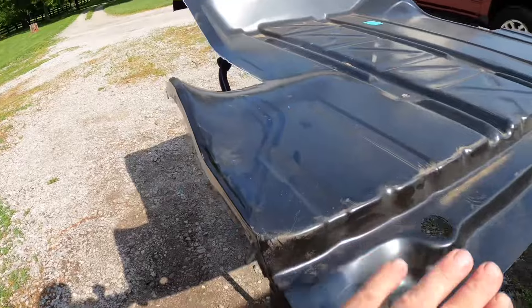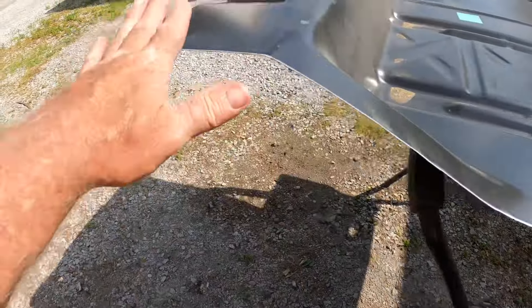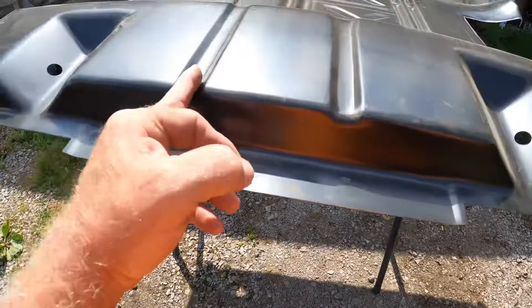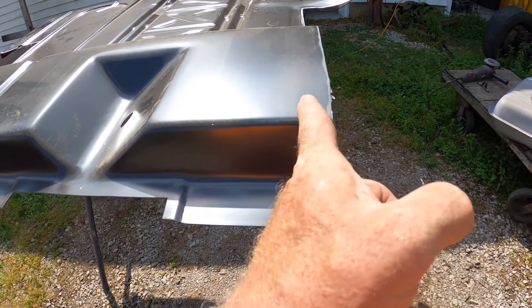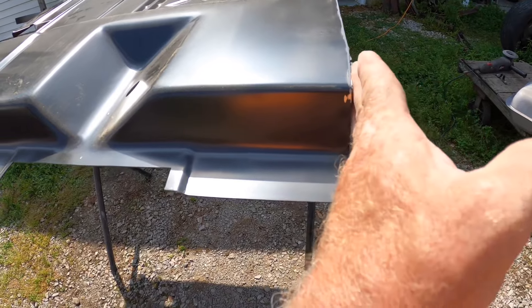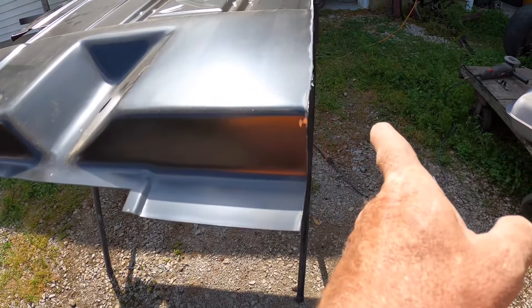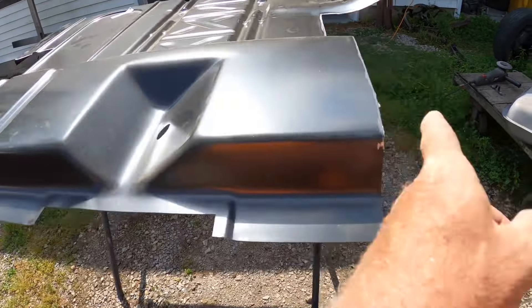So they're all cut out - 18 and a quarter back from the centerline of this hole to here. We've got the width of 41 overall; 20 inches comes to about here. Don't forget we took off an inch and a half so we can put back the original flange - so this is one and a half inches in further. So 20 and a half inches because of the 41 overall, less one and a half inches. When this gets fitted, you will see the rail - that's because we're going to put back that lip on the side so it'll have a factory lip on it.